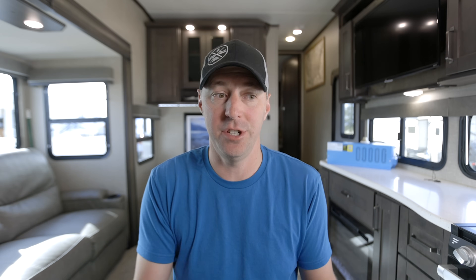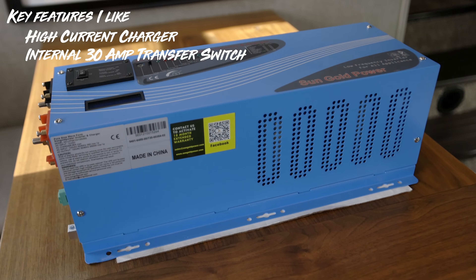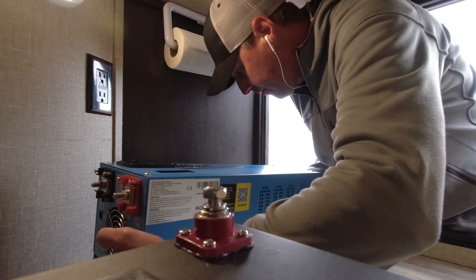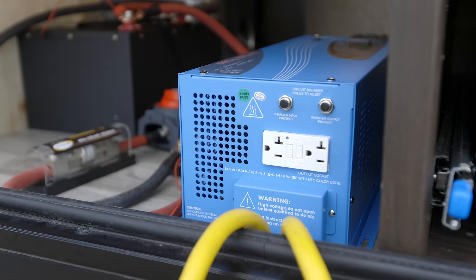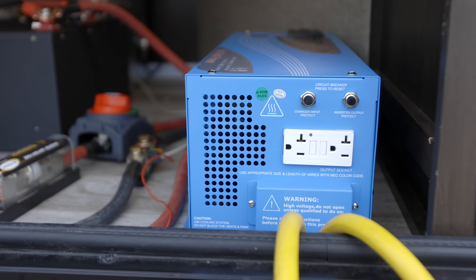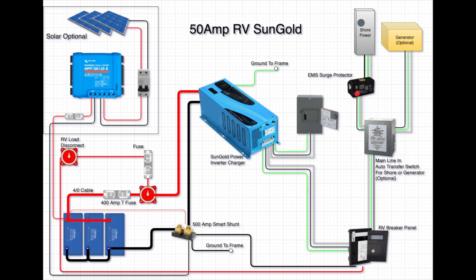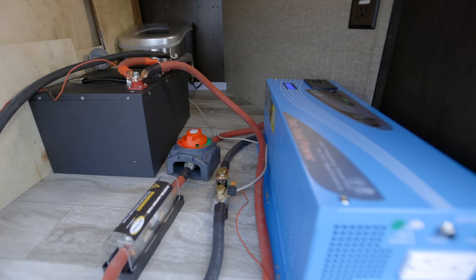As for the inverter, it has a few more features than just a standard inverter — the built-in charger and transfer switch are two big things that make setting up a system much easier. Compared to the Multi Plus, you won't get power assist or remote functionality, but this is a solid budget option that's a good inverter for RVing. Setup is really easy: DC connections on one side, and on the other you can hardwire in or just plug directly into the built-in outlet. On a 30-amp RV it's simple to put in line and power everything. On a 50-amp RV, I'd set it up with a sub-panel.